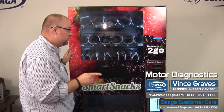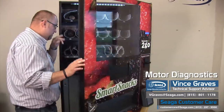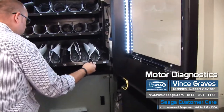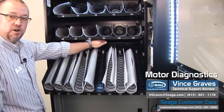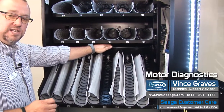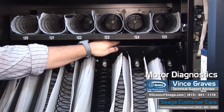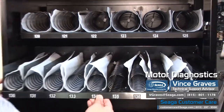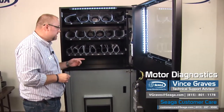On certain machines and certain softwares, you'll want to go to diagnostics and do a clear errors. The next step would be pulling this tray forward to its loading position. With your machine powered off, you're going to need to check the wire harness connection on the motor in the back of the tray. You may need to pull the tray out to be able to see this if you can't feel it with your hands, and you can look back at our video on how to pull a tray to see how to do that. Once you've reconnected your tray harness, you can close your tray back up to its vending position, power back up, and repeat your steps again using a test vend to make sure that your motor is working properly now.